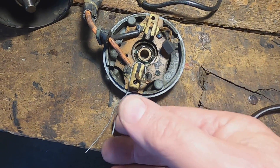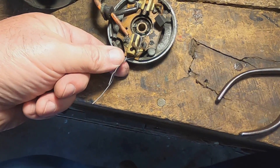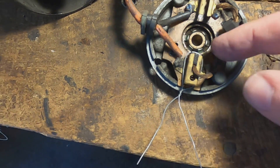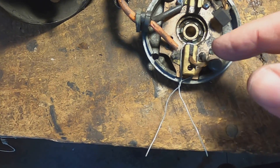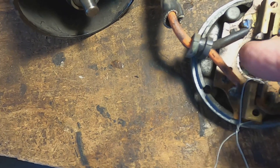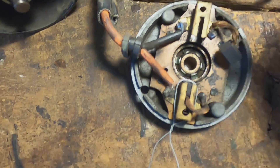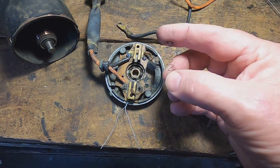I decided to use the wire — I have this very thin wire because the zip tie was just too cumbersome. You can see how the wire goes around this block here and holds this brush in place with the spring. The way this thing is designed, it's almost impossible to put these brushes back in wrong because of this slot up here and the wire. It has to be oriented in this way — the curvature and the brush itself goes around the commutator. So this one is tied up, this one here has yet to be done. Here's the spring I have to put in there.